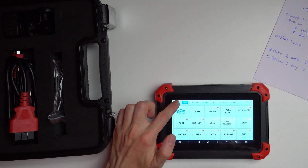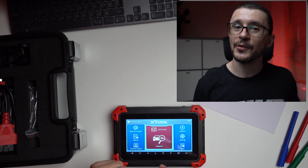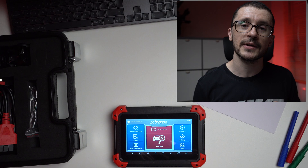Why did I buy it, especially if I already had the manufacturer-specific diagnostic tool? I bought it because this tool has the capability of doing data logging. Data logging is something that ISTA, for example, is not capable of doing, and the tools that can do it are quite expensive. Surprise — this tool has many more capabilities than just the diagnostic bit. To my surprise, after playing around with it, this is something I'm also now using it for. It is faster and more rugged than using my normal computer and the ISTA software.